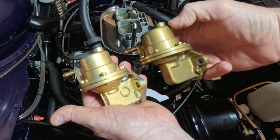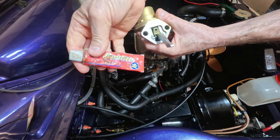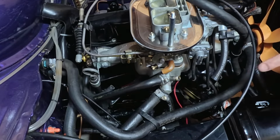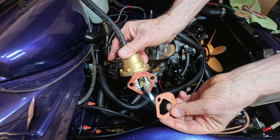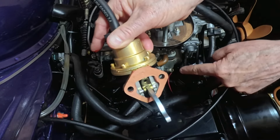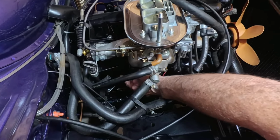They're absolutely identical. We've got a new gasket, and that goes on here with gasket sealer, and also on the top before we go on there. The actual area down the bottom there where the fuel pump is has been cleaned off ready. That's got our instant gasket on. And all we do is put this over the top, pushing down, and then we'll do the same down the bottom there, merely to stop the oil seeping out everywhere.